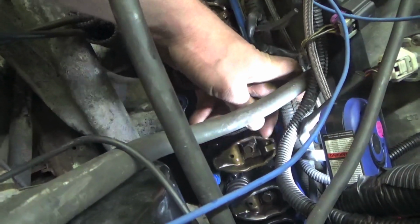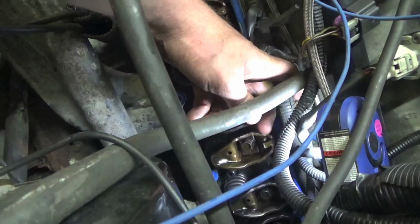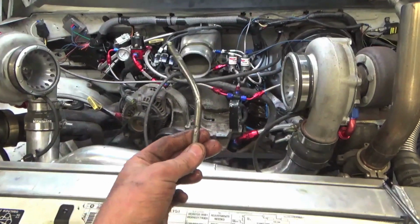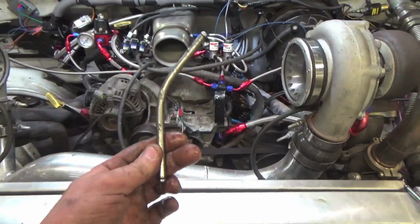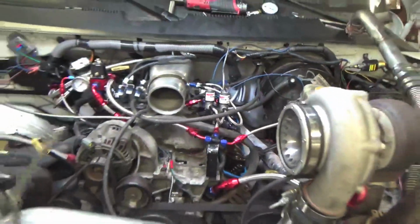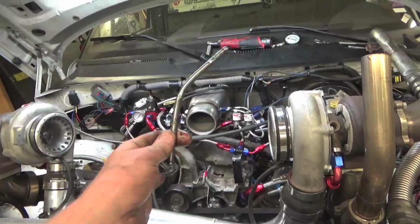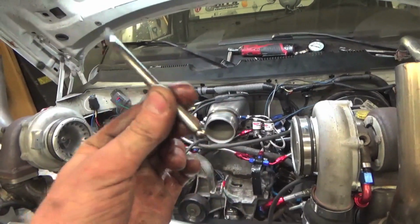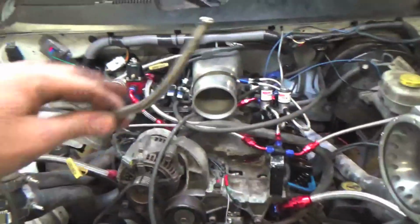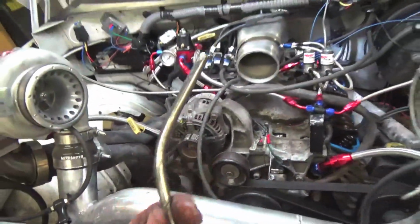There's our issue. There's a nice bent push rod in there, so we're gonna get these rocker arms out of the way, get that guy pulled out. I ain't gonna say that's straight whatsoever, that's a little bent. I'm not gonna blame it on the Chinese Wu-Tang warriors. I ain't gonna blame it on the Nitrous Express wet kit, but I'm not gonna say that that is actually okay. But we found our issue, so we're gonna put a nice new straight one in, and we're gonna send it right back down the road with all the boost, all the nitrous, and everything this little 5.2 can handle, because obviously she's still kicking.